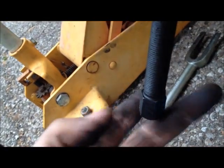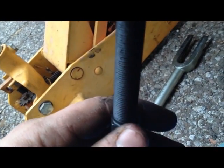We have the gear puller hooked on here and over here on the hub assembly. And then down here, the boot's been torn, so we've moved the boot out of the way, and I've put that middle pin of the gear puller up into the bottom side of that ball joint. And what we're going to do is it's a 17mm socket on mine, and we're just going to start cranking it up with the ratchet, and eventually it will end up pushing the ball joint up out of the hole.